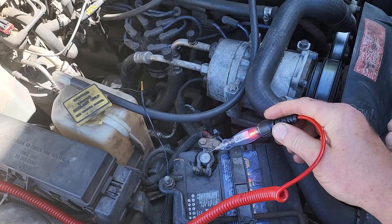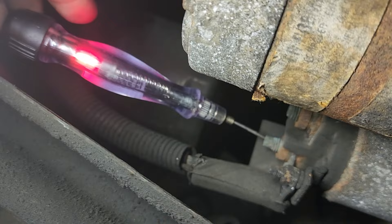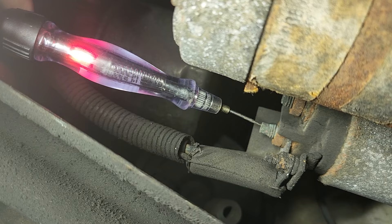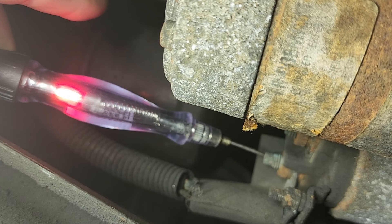I'm going to go to battery negative — actually, I want to go to the post, and there's a reason I want to go to the post and not the nut. Even though it's hot all the time, you can't say that's a good test because there's no current flow. Go ahead and crank it, Caleb. Perfect example of a voltage drop — the fact that this light goes out when we're cranking tells us our voltage drop is occurring on the heavy gauge wire.